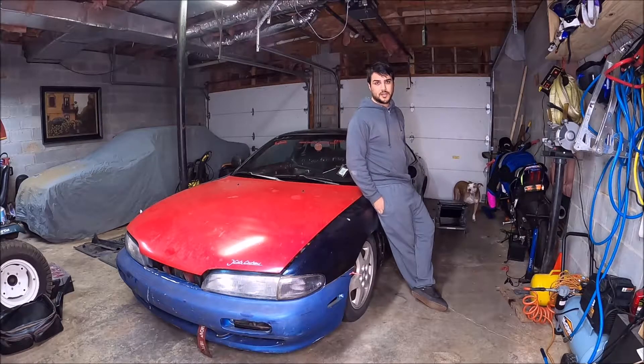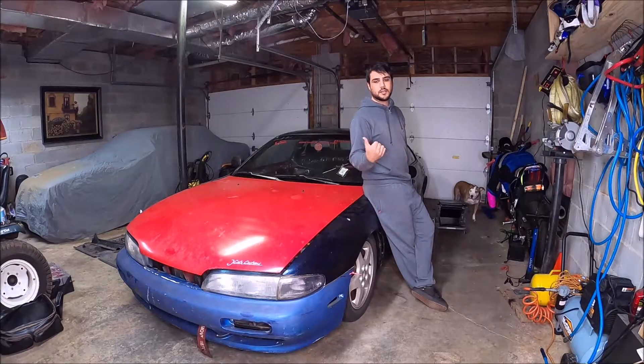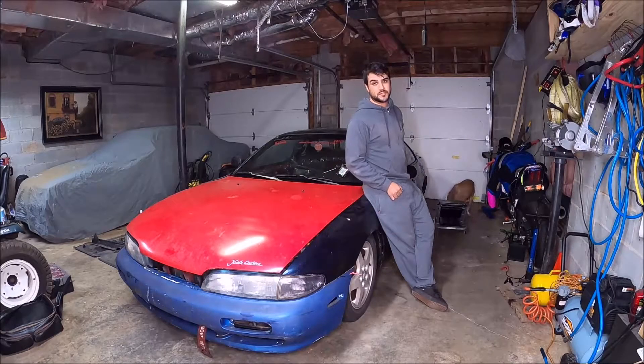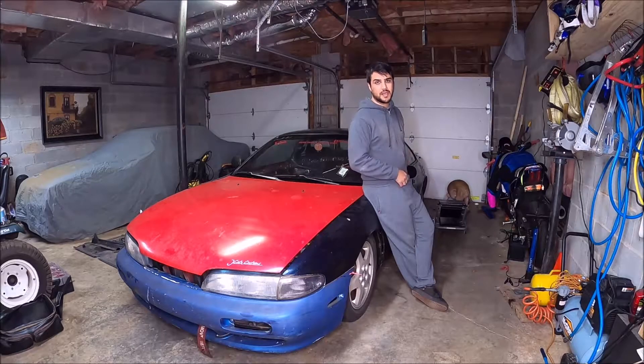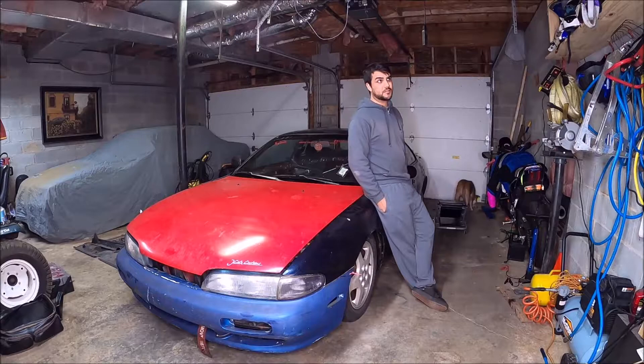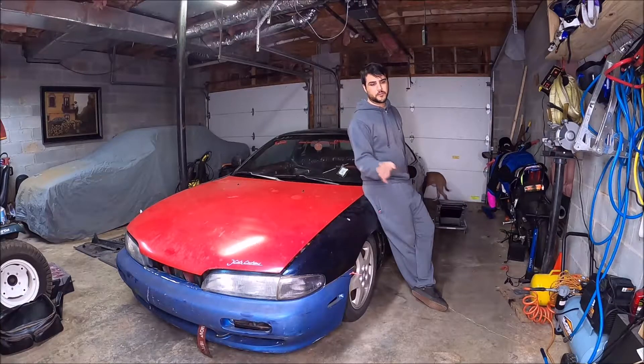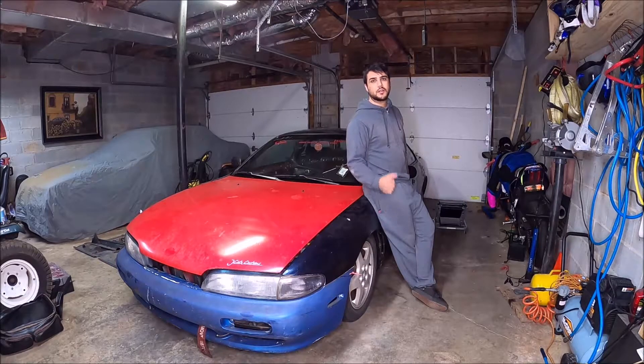We're also going to look at the Hyundai, which I changed the receiver dryer for. I'm not going to make a video about that, so I'll just tell you: I replaced the AC compressor and the expansion valve, recharged the system, and the air conditioning works again. My suspicion that it was the compressor was right - the bearing was bad and it needed to be replaced. The compressor can disintegrate inside the system and send particles into the expansion valve and clog it, so I went ahead and did both. Got lucky I didn't have to replace the condenser, so that's awesome.